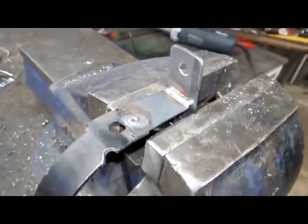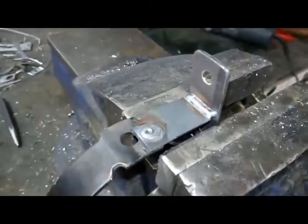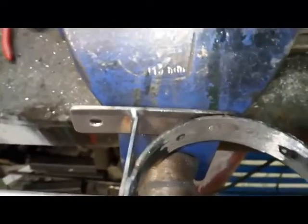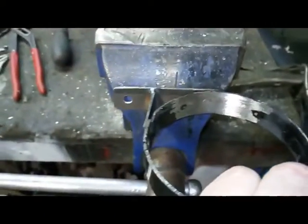I think I've finished the bracket initially. Fitting into the car will require another little piece of metal. All I've done is drill a hole in this guy and plug weld it through the actual BMW bracket. I've done the same thing on both sides and gone over it with the die grinder. So this is just a simple bracket now — when fitted to the car I'll have a captive nut on this with one bolt. The piece I weld to the car will have a feature to stop it pivoting on the bolt and swinging around.